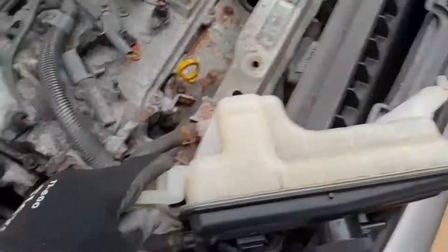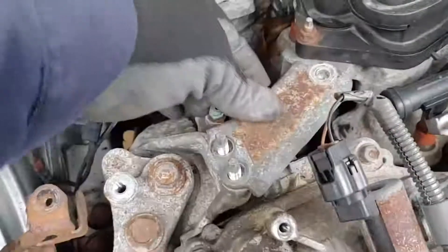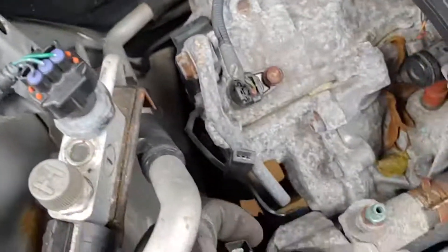So I took this off and put it to the side. I didn't really want to mess with too much because it's so rusted. I pulled off this bracket and this was on top. I'll come down here to disconnect the grounds — when I disconnect this one, it's got a lot of corrosion in there. Green crusties. So before I put this back together, I'm going to try to clean that up as best as I can — pull the connector apart, de-pin it, clean it up real good. I don't know if there are any issues with it, but it's going to be a bit of a preventive thing.